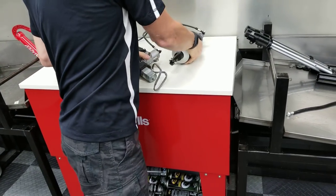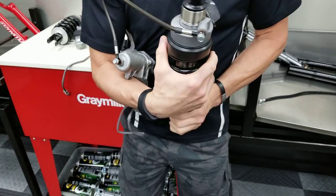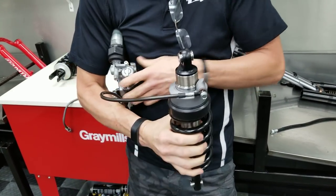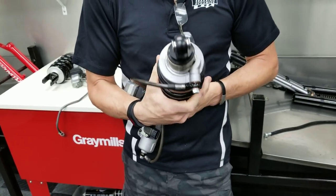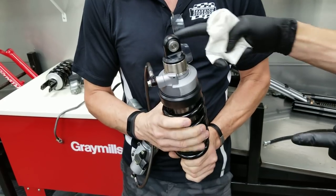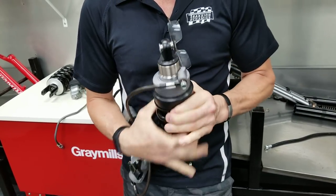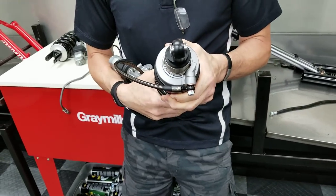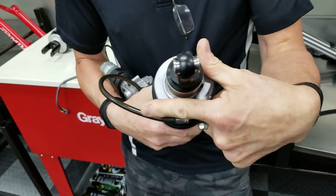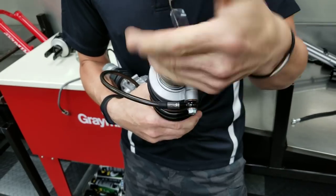For 2018, we clock it slightly different from stock just to make our hose lay exactly how we want. So I'm going to show you, it's basically 90 degrees between the clevis surface. So bolt hole, 90 degrees, bolt going out 90 degrees in relation to the clevis.